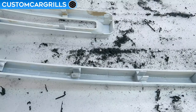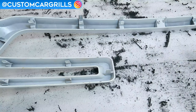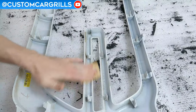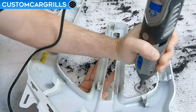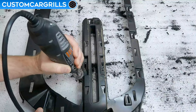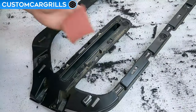There can be quite a few of these spots around the grill. Some might be sticking up more than others, and it's possible that none would be sticking up at all. So in short, if you have any of them sticking up, just shave them down real quick. Also, it's important that if when it comes time to snap the mesh in place the fasteners are not connecting properly, then additional material may need to be shaved off. For this specific install, I needed to shave off about a 32nd of an inch so that the frame would properly secure together with the mesh in there. I ended up carefully removing just a super fine layer of material from both the black plastic and the painted part. The top of the shaping wheel can make quick work of this, but sandpaper can also do the trick. For me, I didn't need to modify anything on the lower edge — it was all on the inner portions and the top edge, but I suspect there will be some variants from grill to grill.